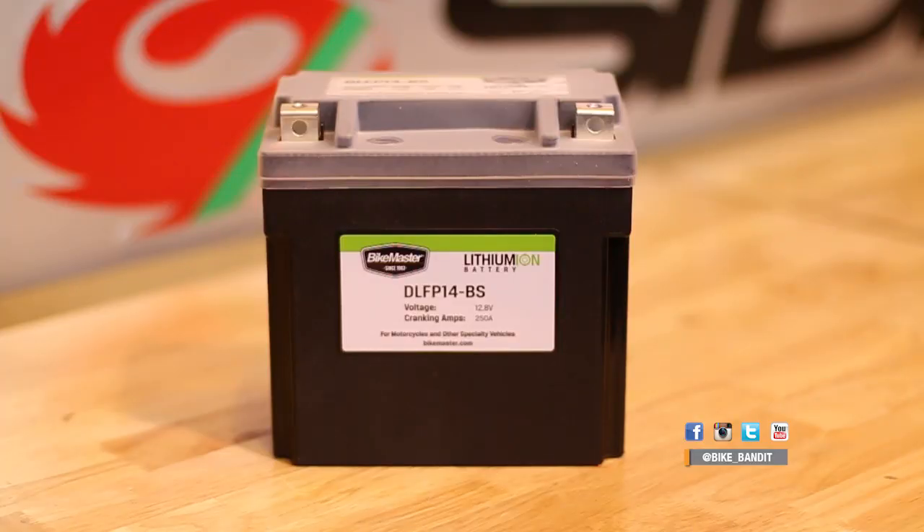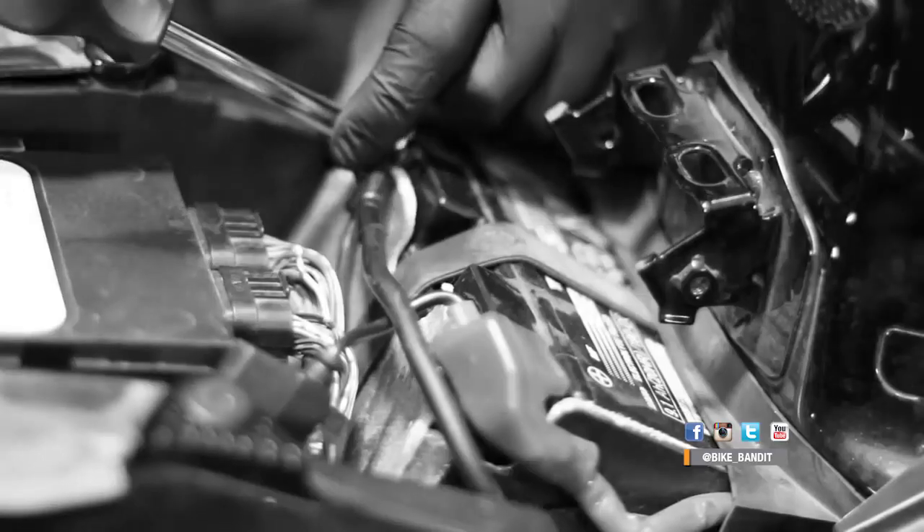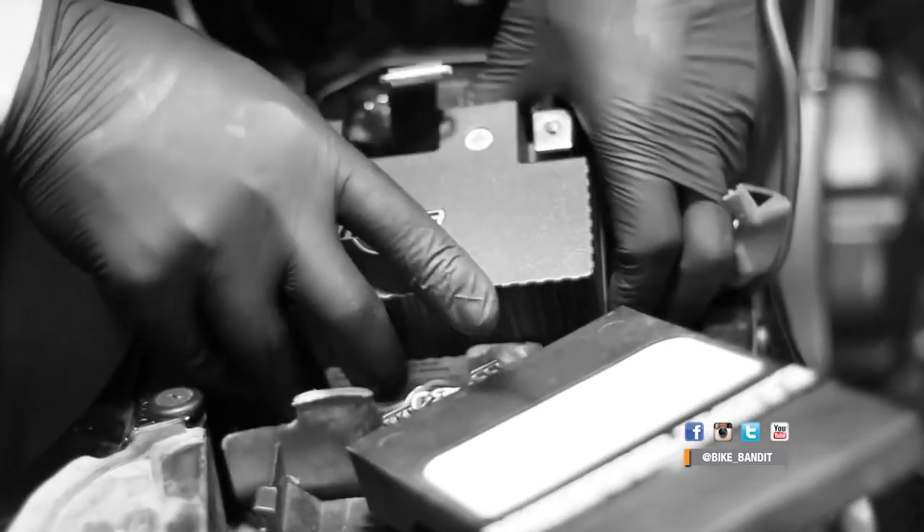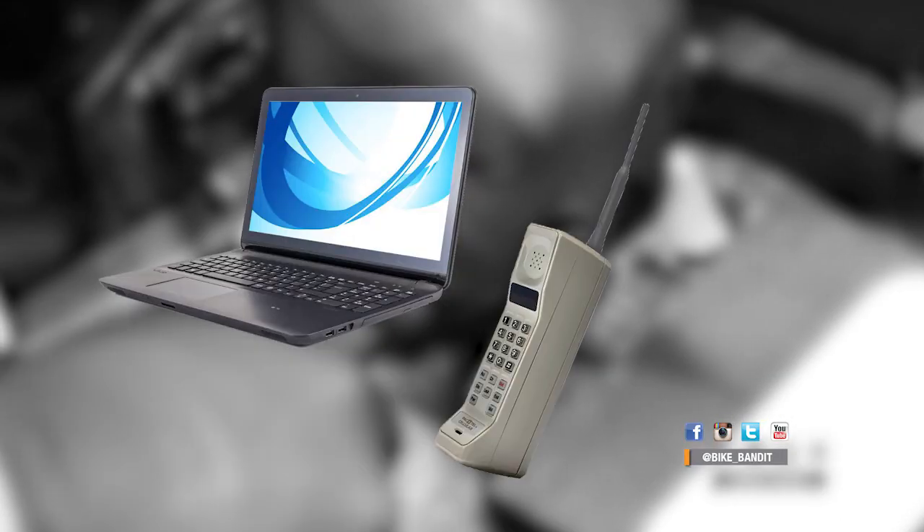There's a new type of motorcycle battery on the market today that uses a completely different chemical composition to create energy — the lithium iron phosphate battery, also called lithium batteries for short. No lead or acid here; these use a chemical reaction between lithium and iron to create energy. Since no liquid acid is used, they are also referred to as dry cell batteries. Note that lithium iron is different from lithium ion — lithium ion batteries power laptops and cell phones and can actually explode. Lithium iron uses a more stable chemistry that is a little less energy dense but much safer, making it perfect for vehicle applications. These really are the batteries of the future in the power sports world.